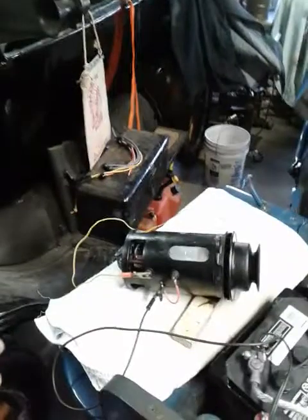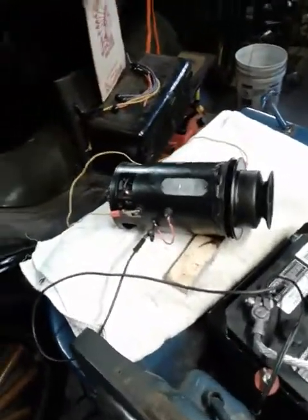Hello friends, Steve Blanchard here again. This is part 9 of the generator rebuild project for an Autolite GDZ4817A for a CJ2A. If you recall in the last episode we had the field coils installed in the generator body. I was pretty close to ready to assemble it — I still needed to sand in and seat the brushes. I've done that, and I've got the generator assembled now, and I'm ready to do a motoring test on it.